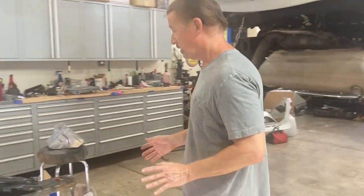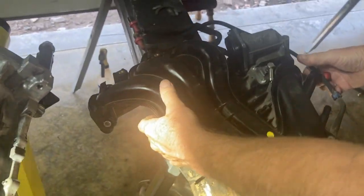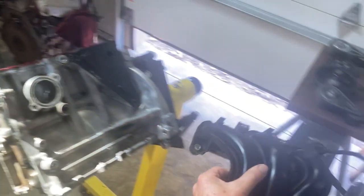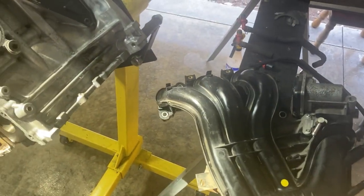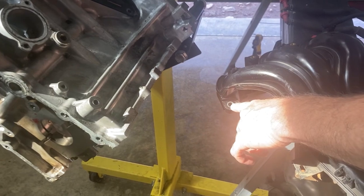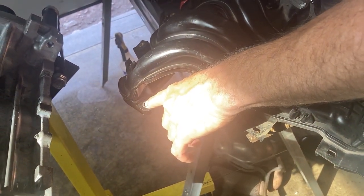Let's check the PCV first - that's a very easy check. This is the intake manifold. When it sits in the car it totally covers the PCV valve, so the only way to get to it is to remove the intake manifold or at least lift it out of the way. You have to unbolt it and lower the engine. This bolt here is trapped by the alternator, so I believe you have to take the alternator out to get to it - but before you do any of that, we're going to do a quick check that takes five minutes.